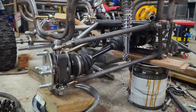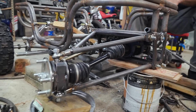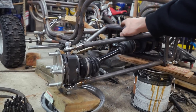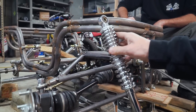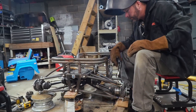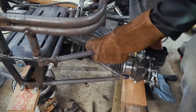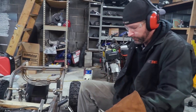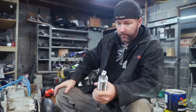Every which way we try to mount the shock, the top control arm is in the way — so it is getting relocated. We're going to run our upper control arm just like so, plug it in right there so it's nice and strong, fish-mouth there, weld it up, then we should be able to get rid of the obstruction and have a good spot to mount our shocks. There it is — much more room now. Let's tack-weld some tabs and test it out.